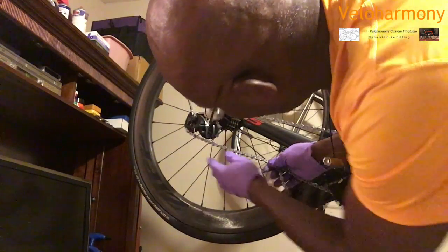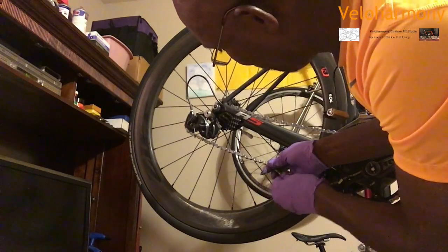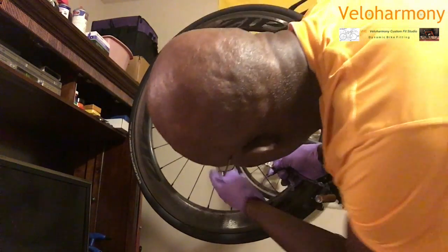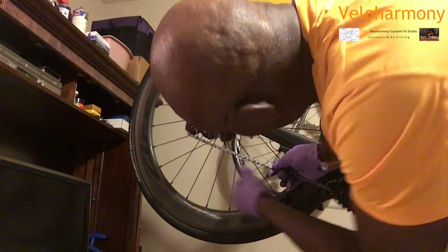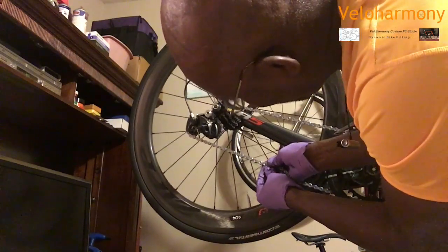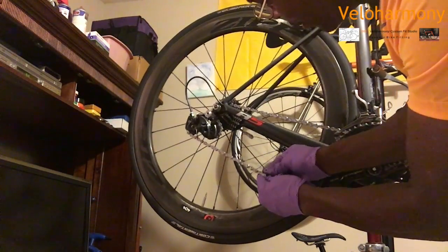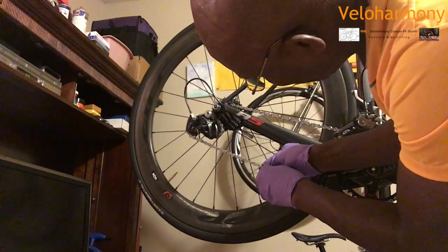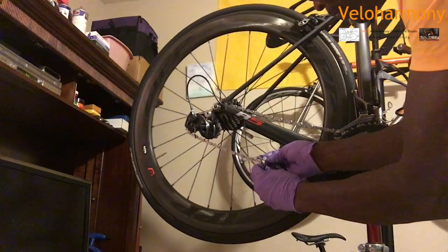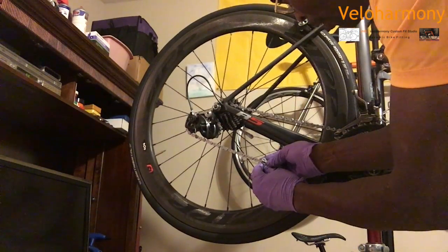See, if I did that right there, see that? That would be touching. So I'm going to pull it a little bit, just a little tension on it, to where you really want about 1 centimeter. So right there seems to be perfect. And you want to do it the way you get a male. Because if I did here, because you only got a male, it's a male on every link there. You don't want to go female.